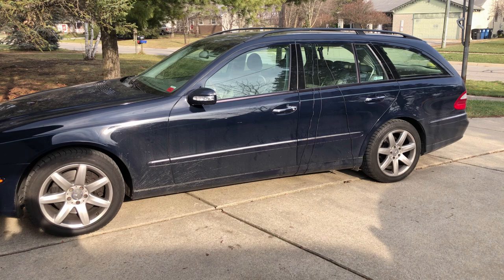Hi and welcome to a quick video tutorial regarding finding hidden or annoying bearing noises. This Mercedes E500 4MATIC has a really annoying deceleration whine - when you're driving around 35-40 miles per hour and you take your foot off the gas, you get quite an audible whine from somewhere in the driveline.